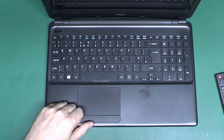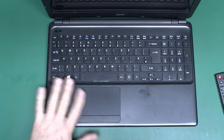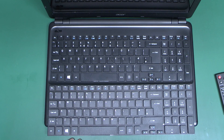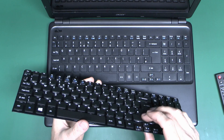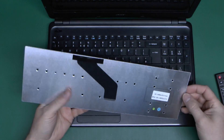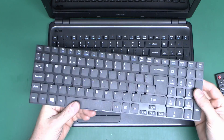This is the front of it here, and it's one of these consumer-type devices built down to the lowest price. Unlike the better-designed ones, the whole of the top is just a moulded slab of plastic, which means the keyboard has to be taken out from the other side. There's the existing keyboard — it's been cleaned up a bit since the cola was thrown in, but obviously it still doesn't work. Here's the replacement — pretty much identical. You can't actually fix these because they're supplied as one unit; the keys are cheap press-type dome things, all clipped onto a sheet, with a metallised back connecting through a flat-flex connector. So if anything gets in — contamination underneath — it's totally wrecked and you have to replace the entire thing.